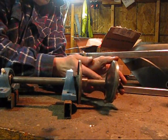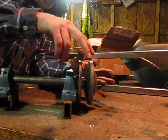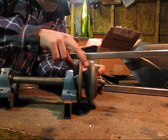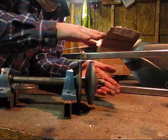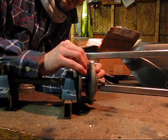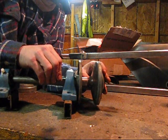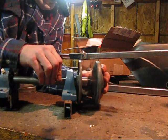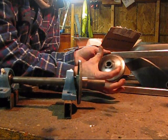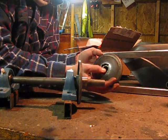So while you're driving and this thing expands out, it pinches on the belt because the weights — it's getting hot. And then when you go to release it, it binds up, pushing in on this sleeve, because it teeters on this sleeve slightly. It won't be able to slide back into place. So a lot of times the culprit is heat, because this part of the clamshell is heating up hotter and faster than the sleeve, so it's literally squeezing in on this sleeve — the tolerance between these two pieces becomes less.